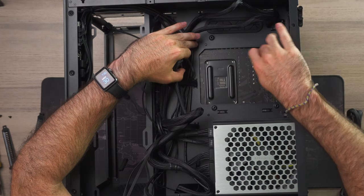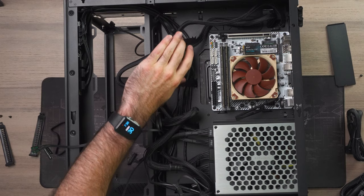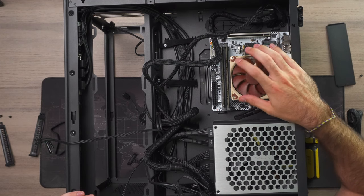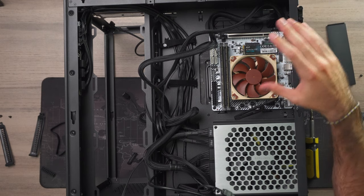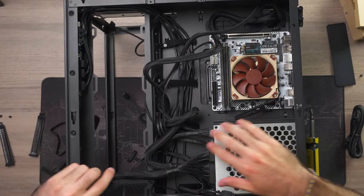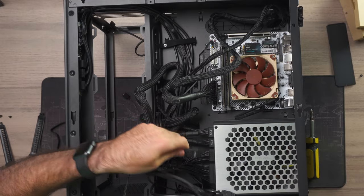The way the secondary system installs is cool — it goes kind of inverted up behind the main motherboard. I do have more room for an even taller cooler back here than expected; right now I have the Noctua NH-L9i, a very low profile cooler. You can actually fit a dual-slot half-height PCI device in this secondary system. I did get a half-height two-slot GTX 1050 Ti, which I'll probably use in a future video — subscribe if that sounds cool.